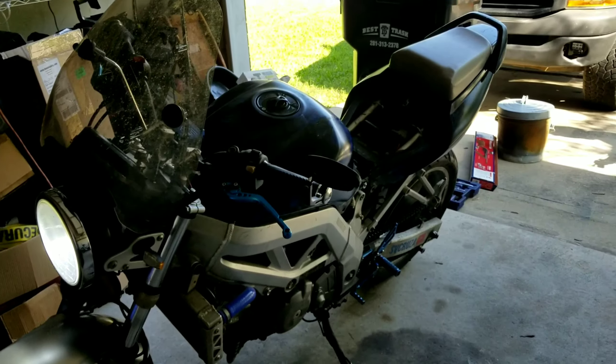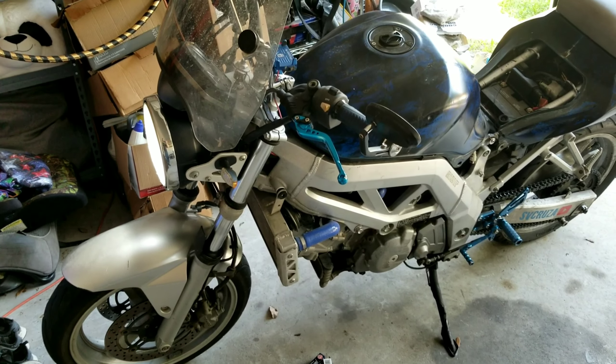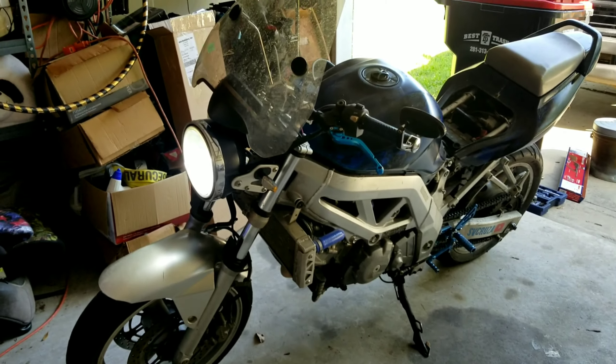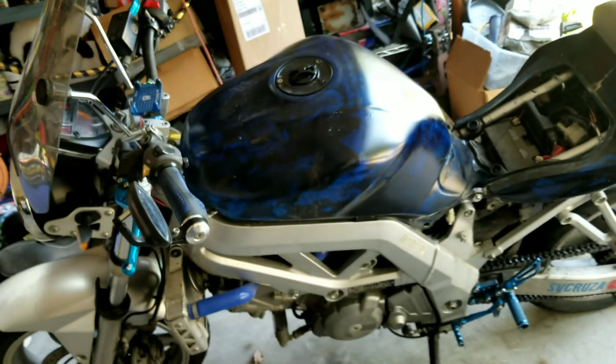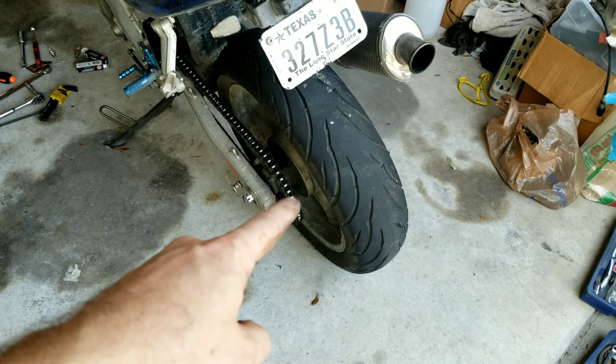Sounds good to me. I'm gonna take a first spin down the road after I clean all this up and put the seat back together. I got the front plug done, the back plug done, checked the air filter - that's good. Checked my fluids and radiator - that's good. Going to put the seat back on, tighten up the chain, and call it a day. With all that said and done, hopefully you guys enjoyed the content. Like, share, comment, subscribe, hit that notification bell, and as always I appreciate you guys watching another episode of SB Cruiser - see you in the next one!